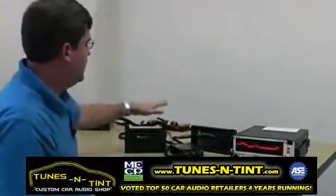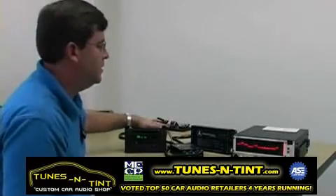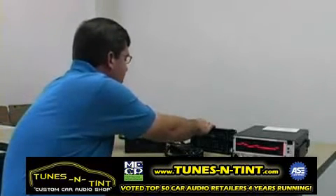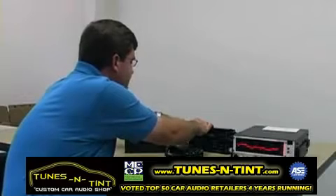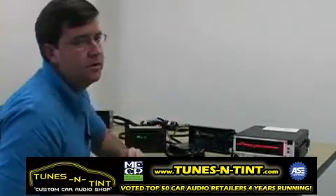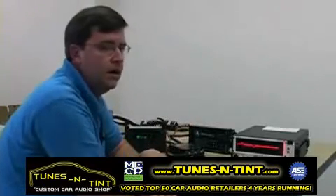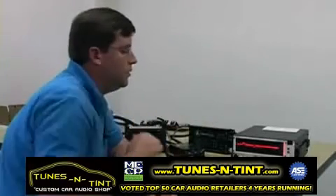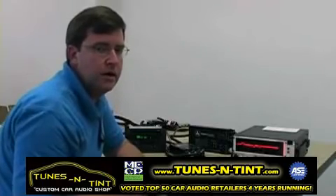So we started with a front high-pass that was equalized, a rear high-pass that was equalized, and a sub-signal that was equalized. We summed them together through the SSI, applied them into the DSP unit, and were able to get very usable flat signals for our aftermarket system. It was all done very quickly and very simply. The whole process of calibrating the SSI and calibrating the DSP should take no more than a couple of minutes once you've got all the connections made.